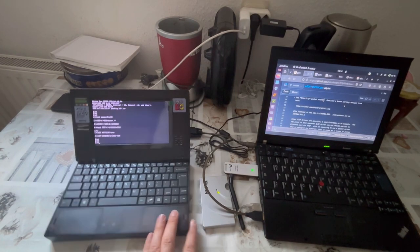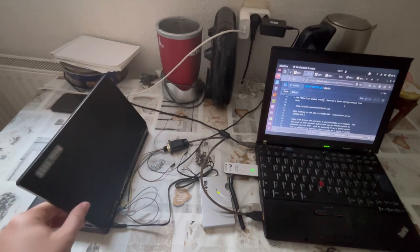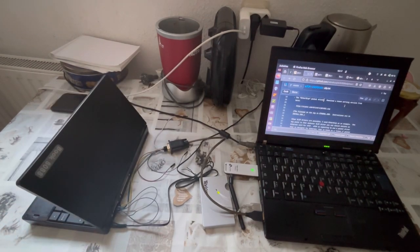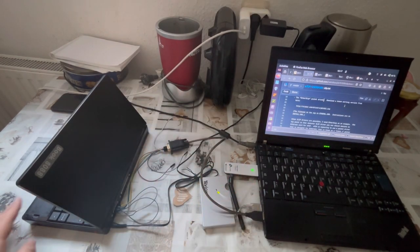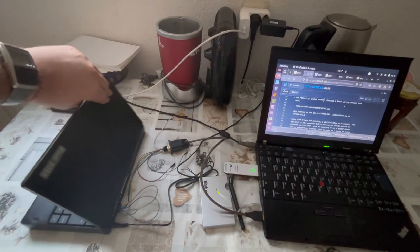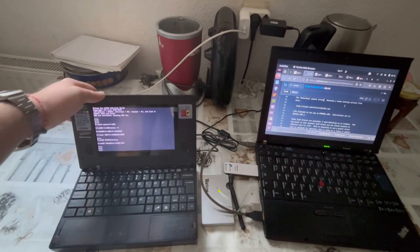We will first need to connect the machines physically. The Book 8088, the Modern DOS computer quite beloved on this channel, has in version 2 a COM port, which is really nice because you can connect it via three wires to a Linux RS232 to USB adapter. And on Linux, this thing here is appearing as /dev/ttyUSB0. It can also be ACM0 for you, but that makes no difference.